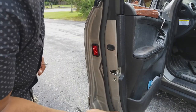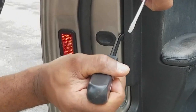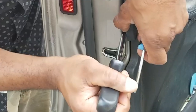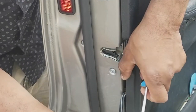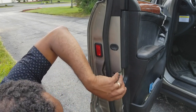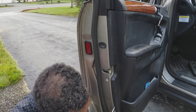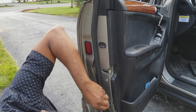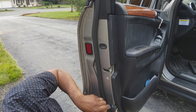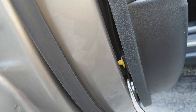I'm going to start by sliding this tool behind here. My job right now is to peer in and look to see where the pins are — here's one. What we want to do is take that notch, this little cutout area, and put it right where the pins are. That holds the panel in place. It's never 100% clear where these panels may live, so I'll put that in there and look. You will pop the pins out — you'll be able to see those pins. See how they're coming loose without being broken? You don't want to break them because then you have to replace them.